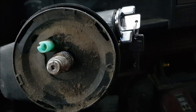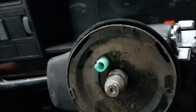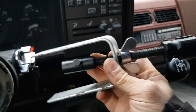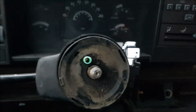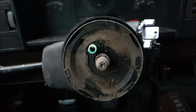You need a couple special tools to do this, and one is a cheap part you can get at most parts stores — this is a steering wheel lock spring compressor. It mounts on and threads onto the hub, and it shoves that spring down so you can get your lock ring in place. So I'm going to set that up and come right back.